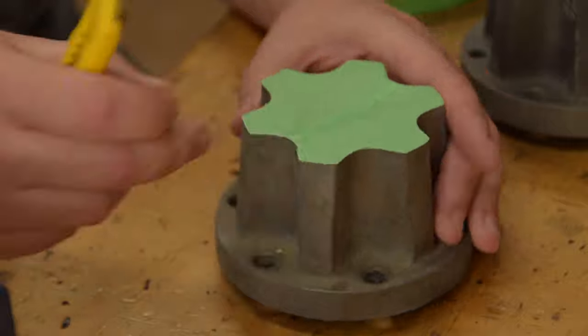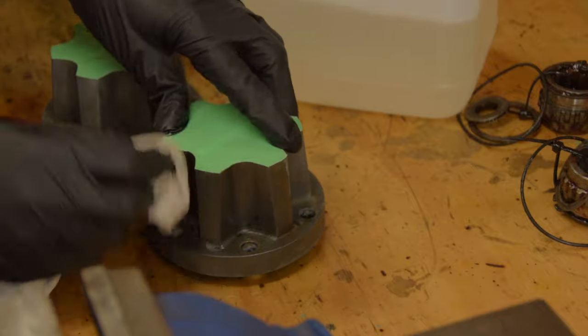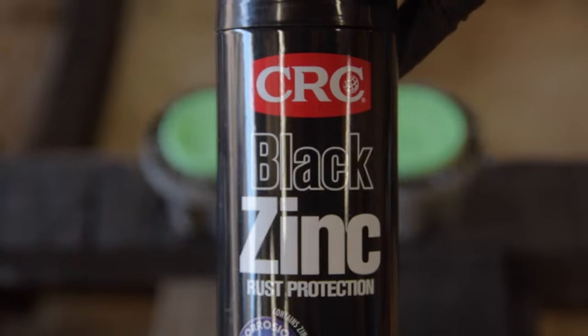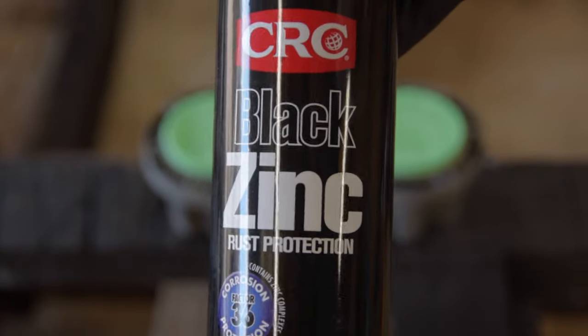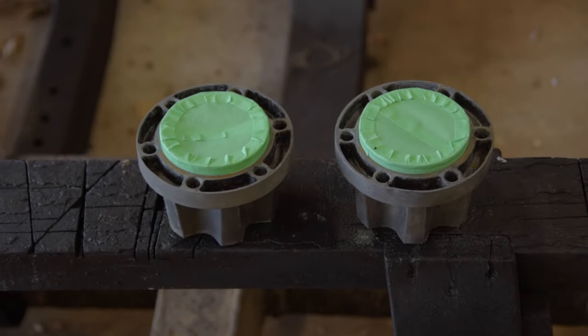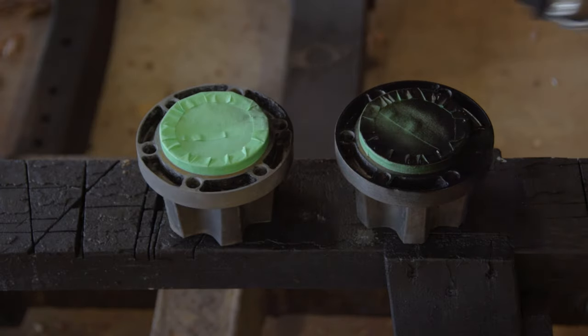Now for paint. It's just black paint, but I'll show the details here so I don't have to cover it in the full axle video that you'll see next week. I used this black zinc as a primer. I would use this as the complete paint, but I can only get it in spray cans, and you get nowhere near the film thickness out of a spray can as you can out of a gun.